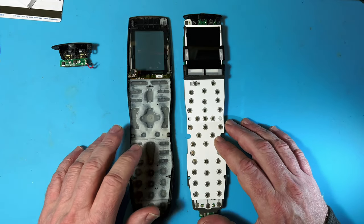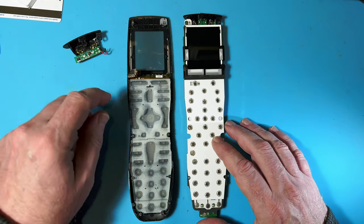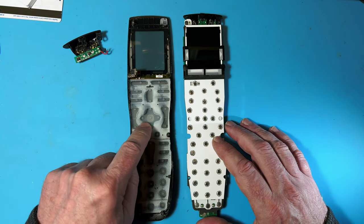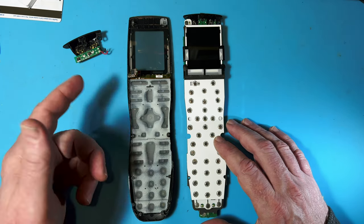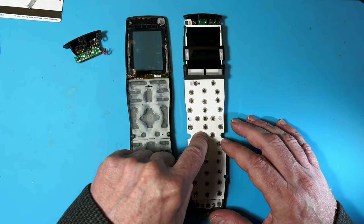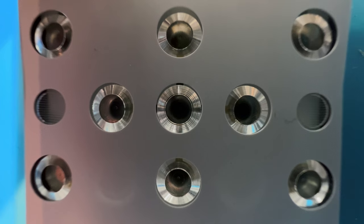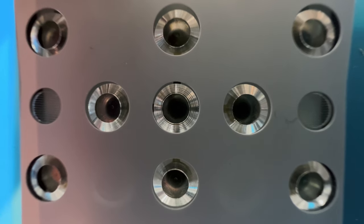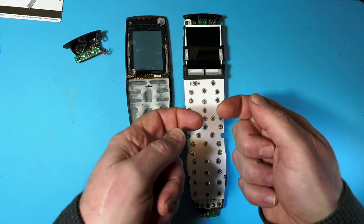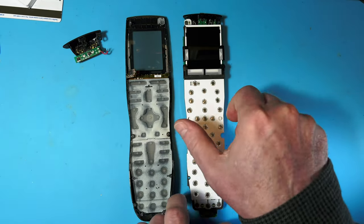I have a few moments before dinner and I'm going to try to swap the charging pad. First off, I was wrong. This is not the light pipe. This is just some diffusion backing on the back of the buttons. The light pipe is this piece of plexiglass, which has lensing in it that brings the ambient light from those LEDs up to points underneath each button to light up each specific button, and this thing comes out.